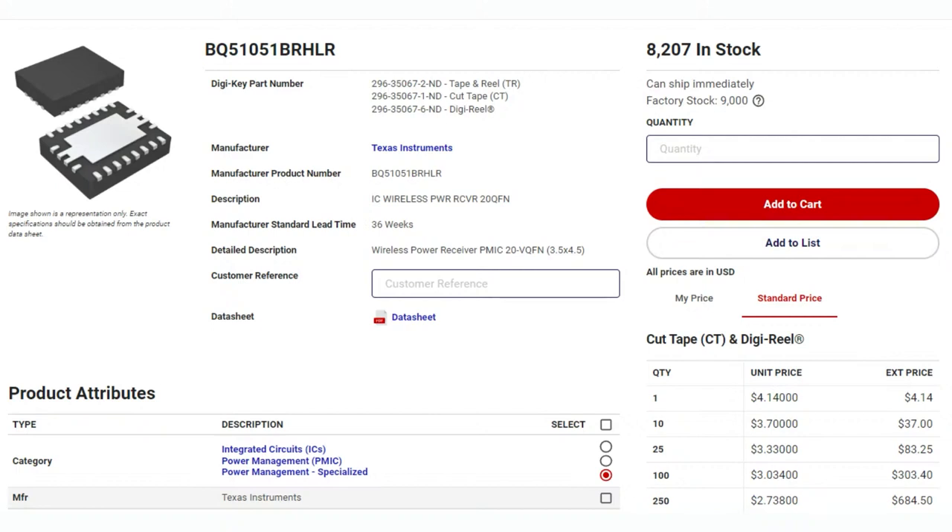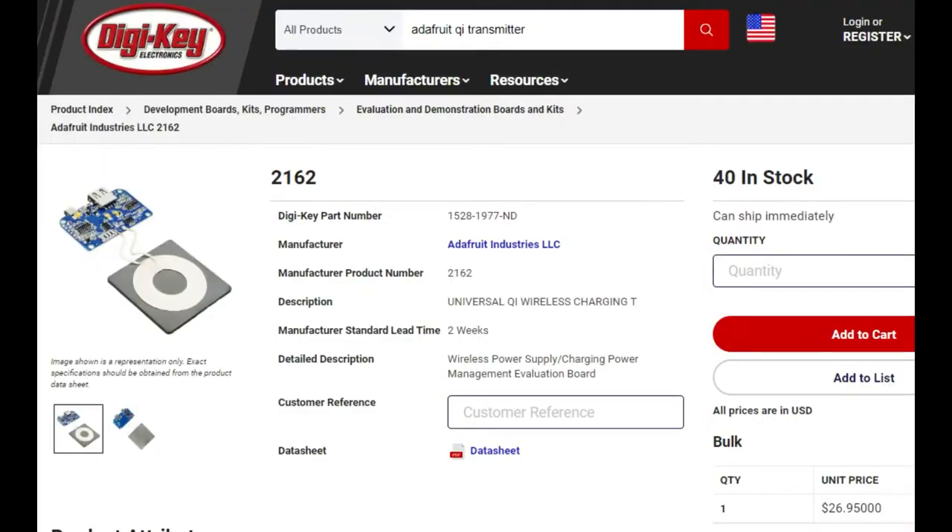I was interested in a watch from a Kickstarter that doesn't even have a USB port anymore — it uses Bluetooth Low Energy for data and wireless charging for power. This is kind of the future, because the moment you're using Bluetooth Low Energy for data, a USB port only breaks or gets dust in it or cracks. It's a major failure point, even with USB-C which has 10,000 insertion cycles — they can just break and the whole device stops working.